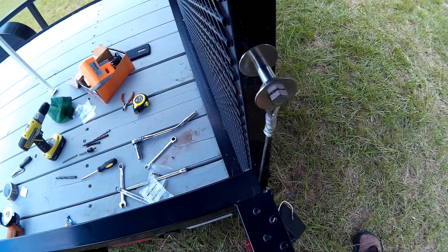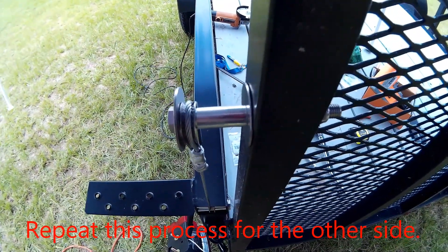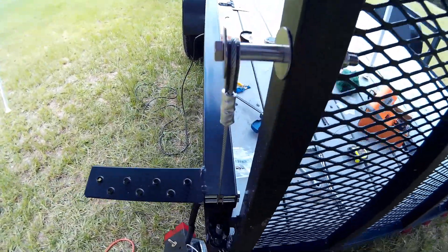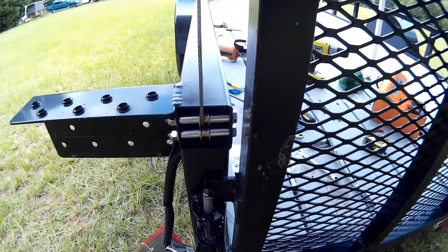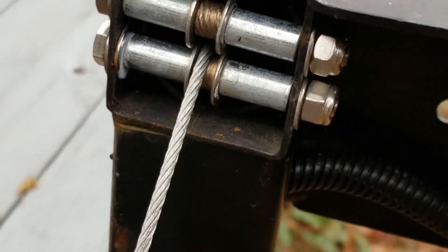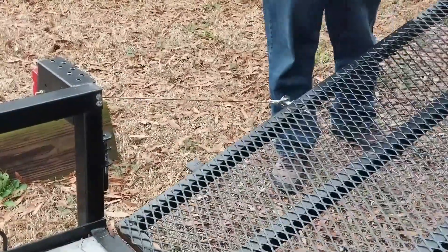Here's what this looks like — you can see the cable coming straight out of the middle of the frame and straight up to the end of that bolt, in perfect alignment. The large washer is going to keep this cable from coming off that bolt accidentally. Here's a demo of the rollers rolling as the tailgate goes up and down — you can see the top one spinning, now the bottom one spinning. As you let the tailgate down, the bottom one goes the other way; then as the cable touches the top roller it rolls to lift the tailgate.